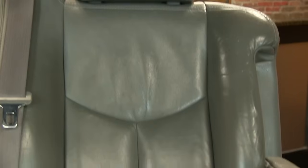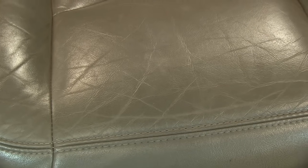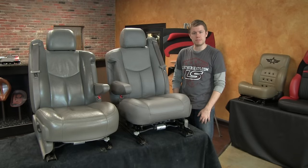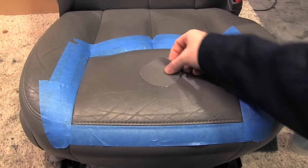As you can see, even though the leather on the passenger seat isn't ripped or torn through, the leather is so worn and dry that some of the surface striations are starting to crack. This mismatch between the brand new leather on the driver's side and the aging discolored leather on the passenger side is the main reason that we usually don't recommend single seat replacements. Though you can do a thorough cleaning of the factory leather using a variety of strong cleaning chemicals, these harsh chemicals also do permanent damage to the protective top coat on your factory automotive leather.